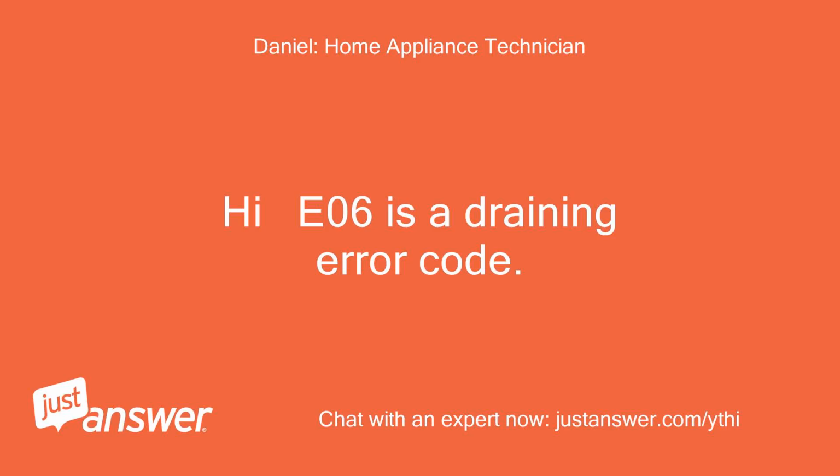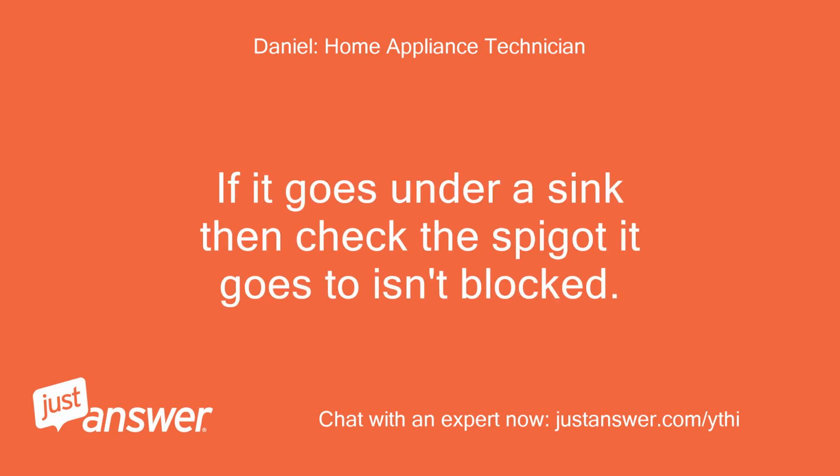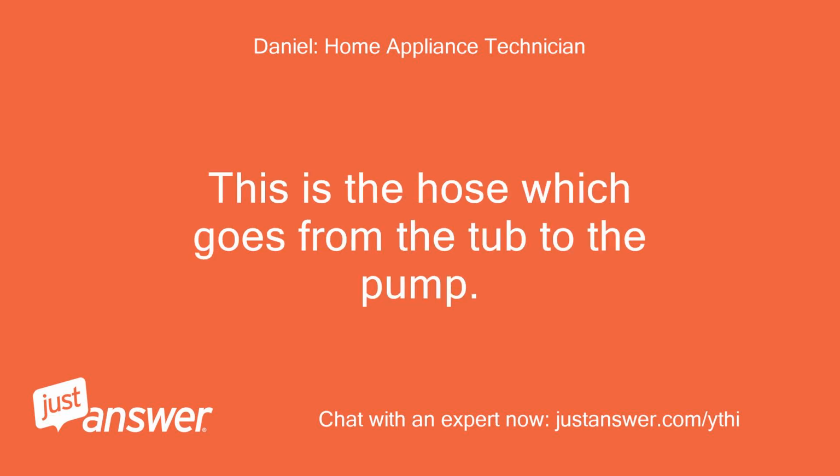Hi, E06 is a draining error code. If the filter is clear, then you need to check the drain hose and where it drains out to. If it goes under a sink, then check the spigot it goes to isn't blocked. If that's all clear and the filter is, then check the sump hose. This is the hose which goes from the tub to the pump.